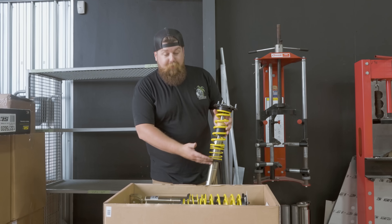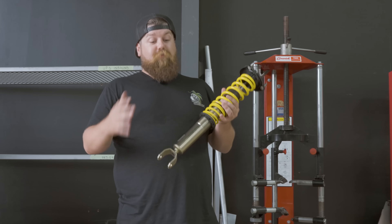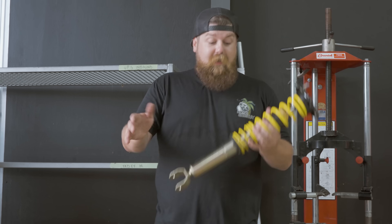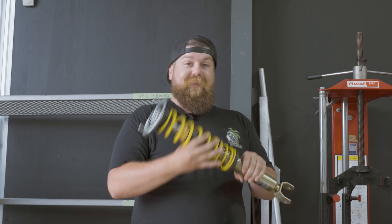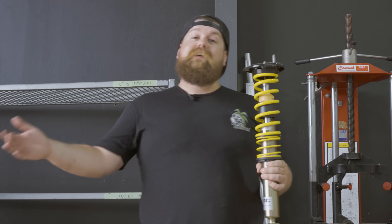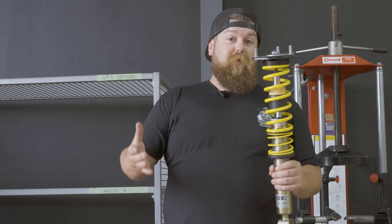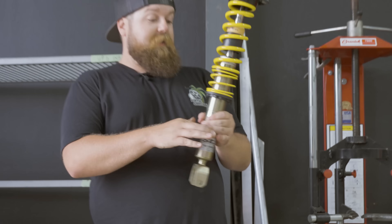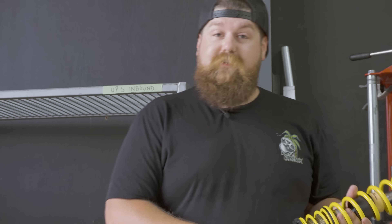So you've got your stock suspension out and you go to open your brand new coilover box, but these aren't ready to go in yet. First, make sure the ride height is kind of even front to back — these will be set from the factory with a pretty safe ride height. I wouldn't suggest lowering the car until you get them in; see where it's at first. On this set of coilovers we don't have an adjustable body, so you'll be adjusting ride height by this perch here, but that is going to affect your shock travel length. If you do have adjustable damping, set that in the middle — if you've got 30 clicks of adjustment, like on a set of BC Racing coilovers, set it to 15, then adjust that later. Adjusting preload is pretty important too — all preload does is make it so that when you jack your car up, your spring's not gonna go floating around anywhere. This one's pretty much ready to go in once we make sure it's level with the other side.